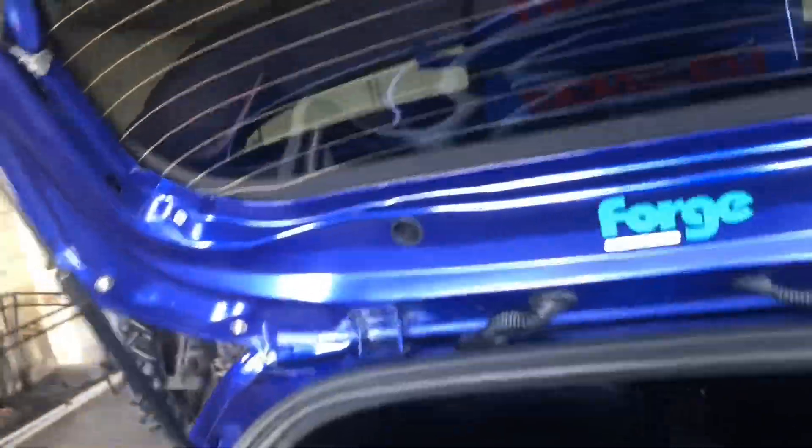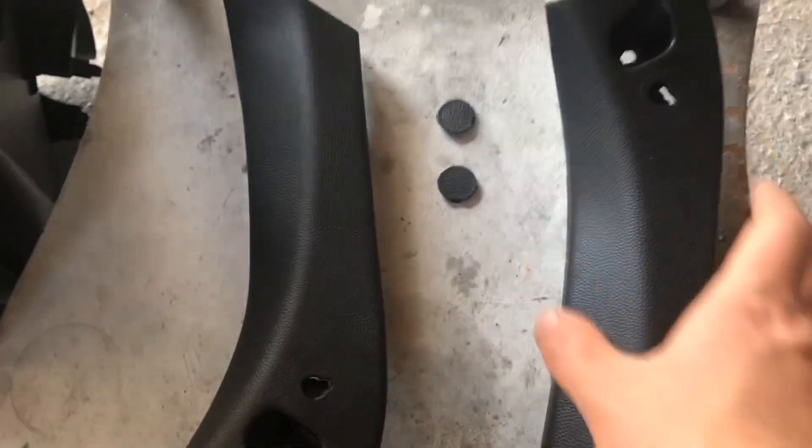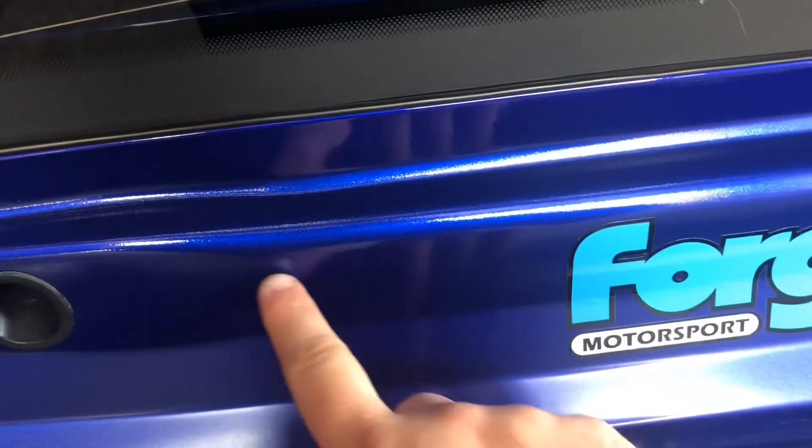Whatever you want to get these black plastics off — a lot of people remove them when they do a rear wiper delete. There's your rear wiper motor; you just remove all of this when you take the wiper arm off and then put your new panel on. Body shops do it, or you can get them from Laird Performance. To take it off, you've got one screw in the side panels on each side, then they just pop off. You've got one screw inside the hole where you pull your handle — the rest is literally just clips. Don't be scared to give it a damn good tug. You can tell Ford definitely skimped on the paint when they painted these cars — look, nice and glossy here...